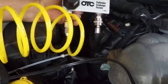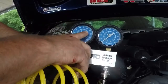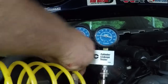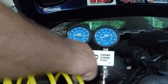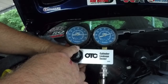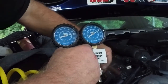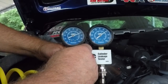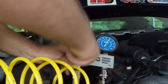Now we're going to hook it up to the leak down gauges. Before I turn this on — as soon as I turn the air on, it's going to turn the air compressor on and you won't be able to hear me. But we're going to look for how much air is going in and how much stays in. The breaker bar is trying to move, but it's stopped on the heater hose, so we're good. We've got 82.4 and about 77 before the air compressor kicked on. I can feel it coming out the valve cover, so it's leaked past the rings — but that's not a bad leak down rate for this car.